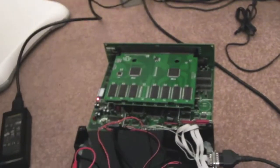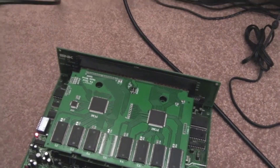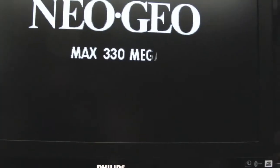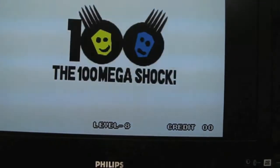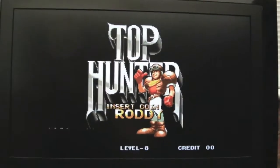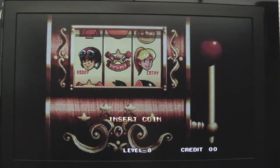I don't know. I'm out of my depth here. I really am. I might see if I can get Dave Jones or someone to see if they can shed any light on what I'm experiencing, because I don't really know what I'm experiencing here. Again, let's say finger on there, it comes out of the Watchdog, the game's fine, no graphical corruptions, and everything's just perfect. Move it away, trouble starts, and if you're lucky, you just get the graphical corruptions and you won't get a Watchdog, but it probably will go into a Watchdog reset in a minute.